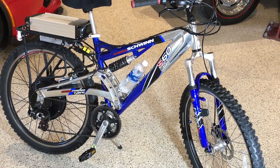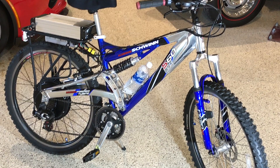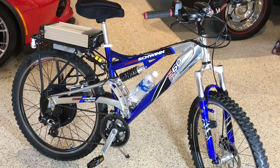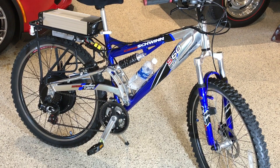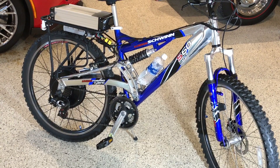The bike and I combined are about 270 pounds and I live in a hilly area. In one spot, I climb about 230 feet of elevation in a half mile, and the bike is able to manage that without any assistance. I do end up assisting the bike by choice on the steepest hills because the speed usually comes down to a point where you can pedal in a medium gear and lend a hand. Granted, a human rider can only put out about 100 watts in theory, but it does seem like more than a 10% boost and may help keep the motor from overheating.